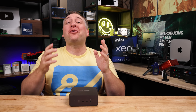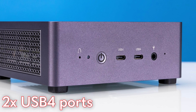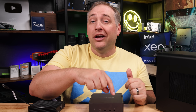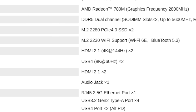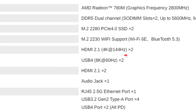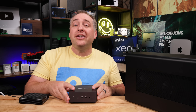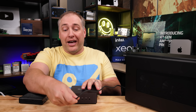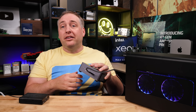Let's start with the outside — specifically the front — because the first thing you're going to see is definitely the two USB 4 ports. These USB 4 ports are awesome. One fun example is that you can run DisplayPort displays off of these, which means these are actually our second and third display outputs. The specs say they can actually do up to like 8K60 on these ports, which is absolutely awesome. You could also use them for devices like an eGPU chassis.